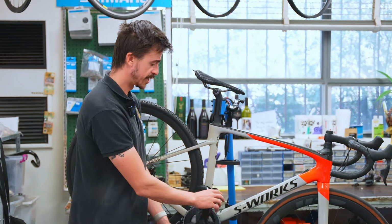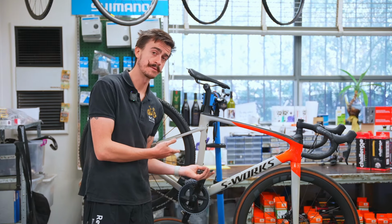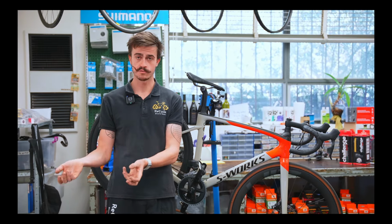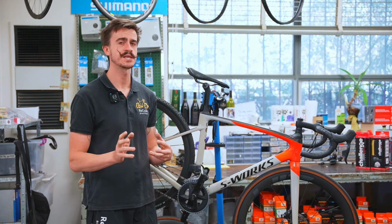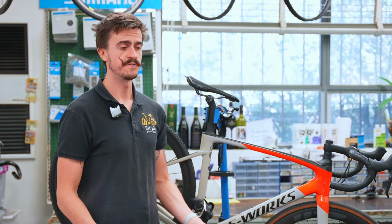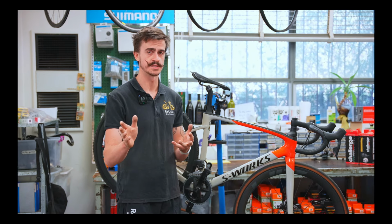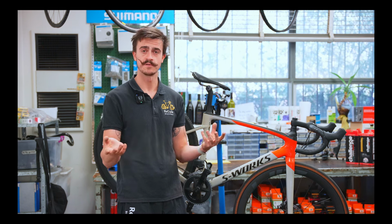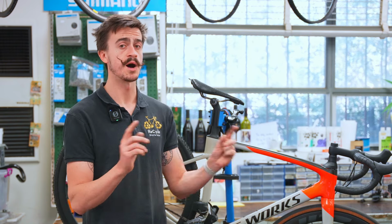And then if we work our way down to the other contact point, being our feet, we can look at pedals. If we're on a road bike, we probably have road bike pedals, whereas now that we're trying to convert it to a gravel bike, since we're going to be off-road, sometimes we're going to have to get to difficult sections of trail where we might have to dismount off the bike and walk along. If you have road bike cleats and you've tried to walk along gravel, you already know how difficult this is, but if you haven't done that, just take my advice that it is very difficult and you'll scratch up your $500 carbon fiber shoes. So you might want to move across to some gravel bike shoes or mountain bike shoes.